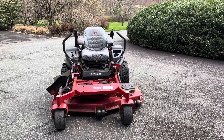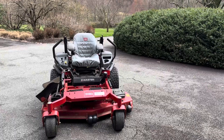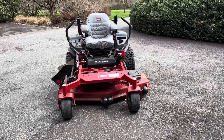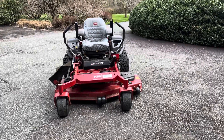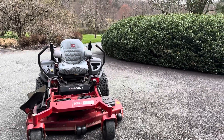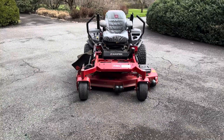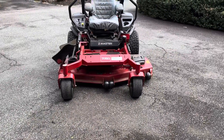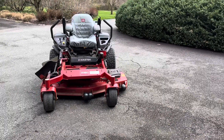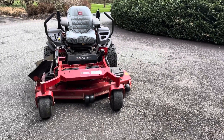That's why height of cut changes how much air can get into your mower deck. The lower you cut, the more you're reducing that gap from the ground to the bottom of the deck shell, therefore reducing the amount of air that can enter. Raise it up and you're increasing the amount of air. If there's too much air and not enough grass, you're going to start blowing air out in random directions, changing the airflow of your deck and losing the even lift-cut action from the low pressure zone. It's essential the deck has enough grass clippings so it doesn't get overwhelmed by incoming air and start losing airflow in random directions, ruining cut quality.